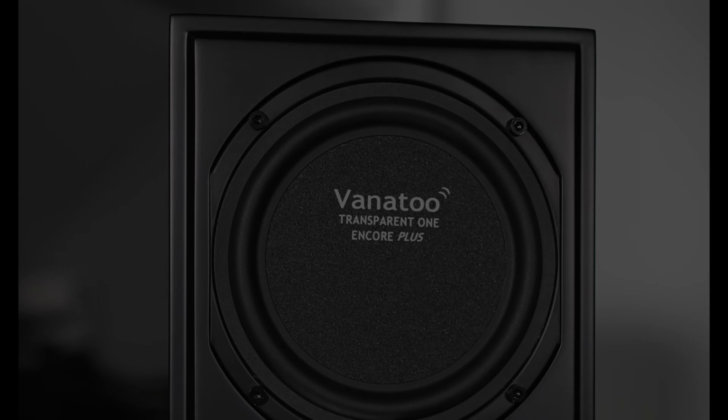So you do get a little bit of that. And if you don't like as much mid-range, you want to bring that down a little bit, you'll probably need to turn the bass down just a little bit in the EQ setting, or even turn the treble up. But I think you should start off with the flat DSP. And like I said, I know it comes out of the box as shelved, but I think flat actually sounds better when it comes down to the entire frequency range.